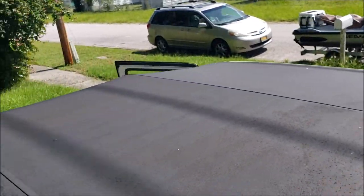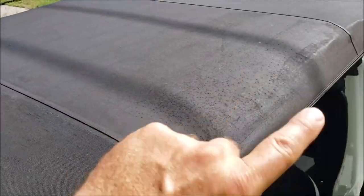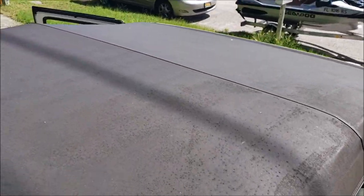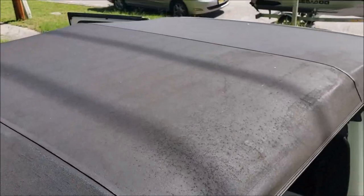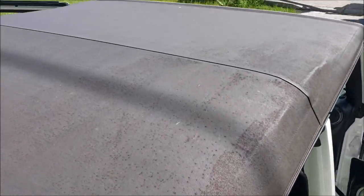It's removing all that mold. I've done this section right here — you can see the difference. This corner was really bad, basically all of that. All I'm doing is spraying the Universal Clean and Prep on and using a hard bristle brush to agitate everything and remove it from the pores and the surface. After that I wipe it with a damp microfiber towel, and then we'll go into putting on some protection — the Marine Series Plastic and Rubber Hydrate. It's made for extreme weather environments and black trim or plastic, which is what this top is.